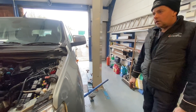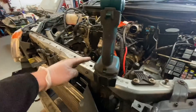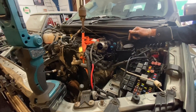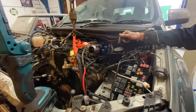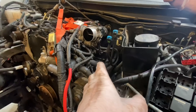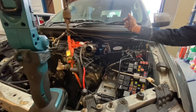The gearbox had a good eight to ten inches of play up and down without undoing any bolt. I know quite a lot of you were concerned about why we didn't pull the engine out with the gearbox together — the front panel doesn't come off on this Ranger, it's actually welded on, and that would have been a whole other story. So we've now got it sat in. It's going to be underneath from here — the painful stage of doing up all the bell housing bolts. Chris already did up the starter motor bolts 90% of the way, so that big headache should be okay. We'll crack straight on and get as much of this plumbed back up as we can.